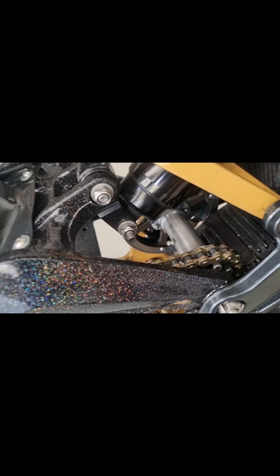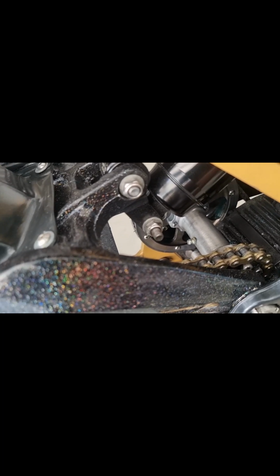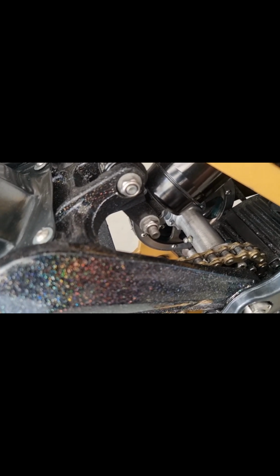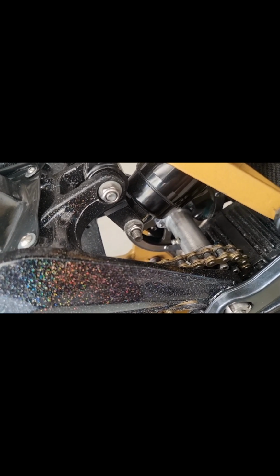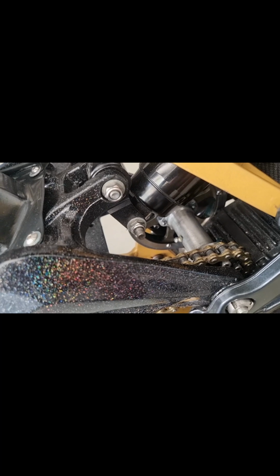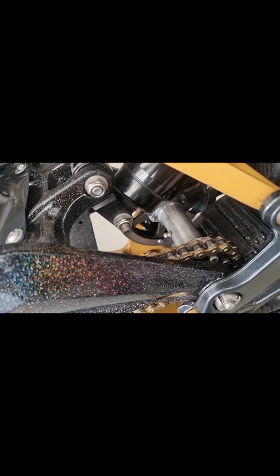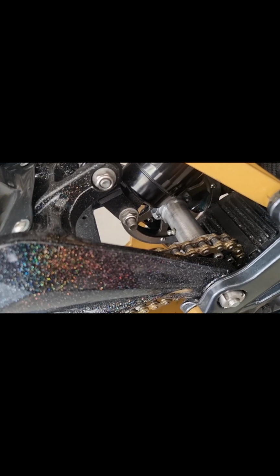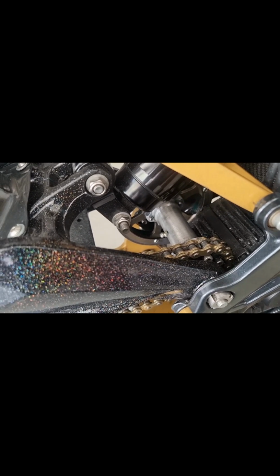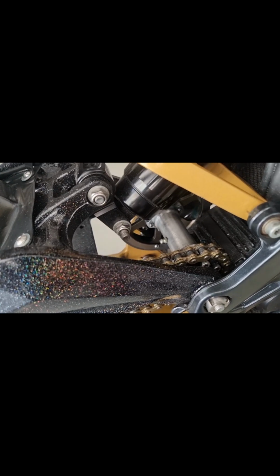All you do is take the bearings out, put fresh ones in, take all the seals off, drill a hole, make sure you clean it all out, tap and die yourself in the grease nipple and Loctite it in, and then you have a re-greasable jackshaft, which means you should be able to replenish the grease very regularly, which will then extend the life of your bearings. You don't need to buy these expensive 3-piece ones that foul and break, that run untrue. You can simply modify yours for the cost of, it's under 50 bucks or whatever it is, and then there you go, you're done.